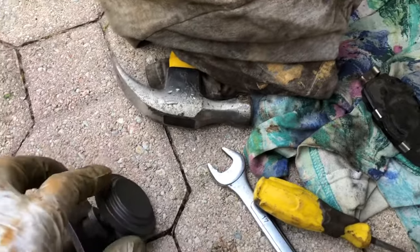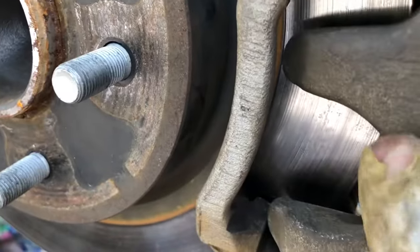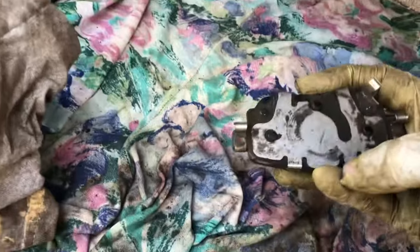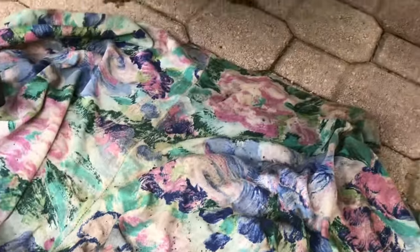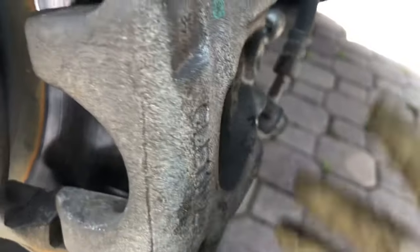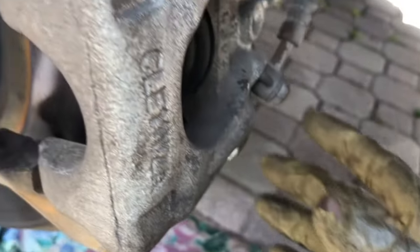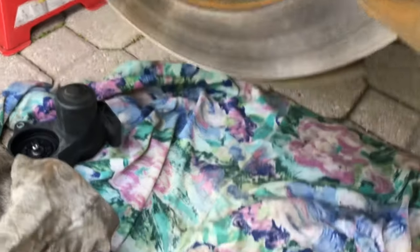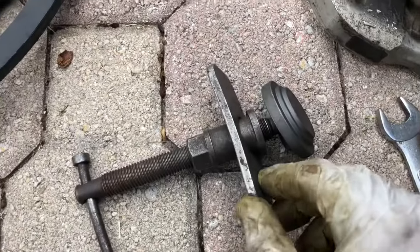What I did is I just pushed it in with this flat one. You don't want to rotate this because there's a notch here on the brake — right there — so that has to go back on it. You don't want to twist it, you just push it in and it goes very easily. Because if you twist it, it's gonna be hard to align this back. So just push it in nicely.